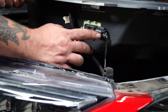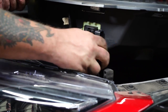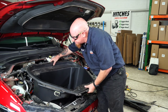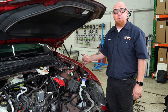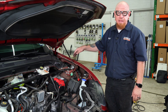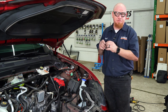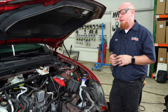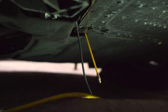As we're pulling out this pan, we've got the emergency release connector here — we're going to push down and pull that out — and we've got our light connection here as well. We do need to get to the black power wire that we ran from the rear of the vehicle. To do that, we've identified a hole in the bottom of the frunk area. We're going to use a fish stick, which is a fiberglass rod about four feet in length — you can use a fishing pole at home, something that's narrow — but you want to use something fiberglass, avoid metal if you can. That will allow us to run that rod down, tie our power wire with some electrical tape, and then pull it right back up to the top.